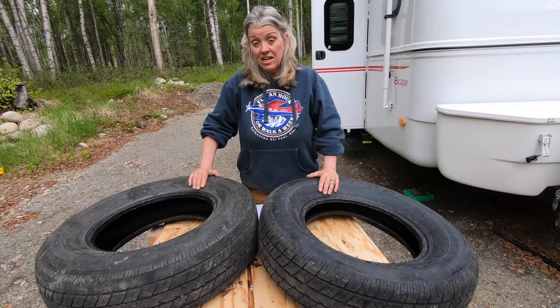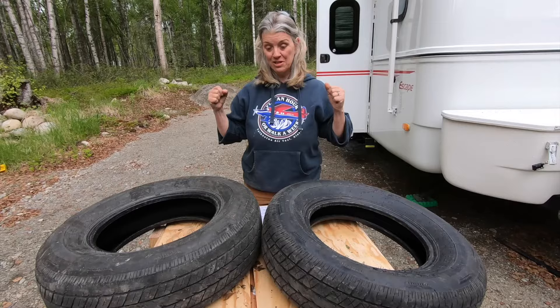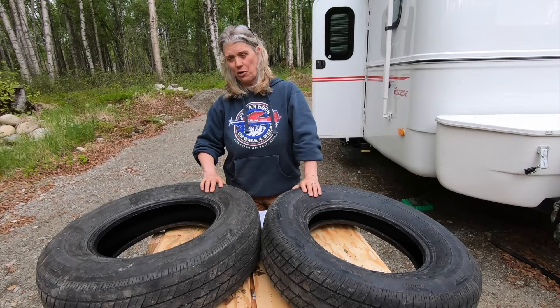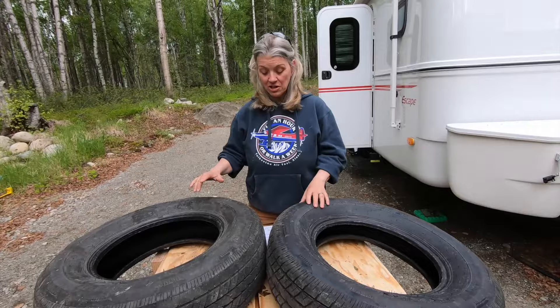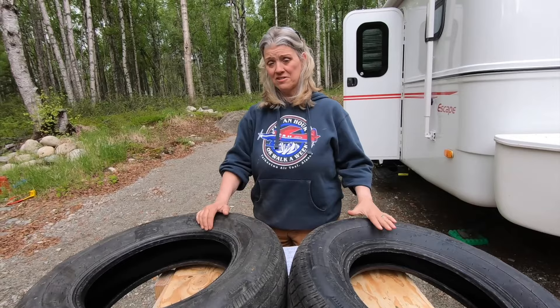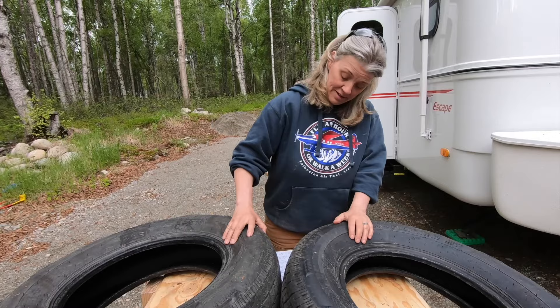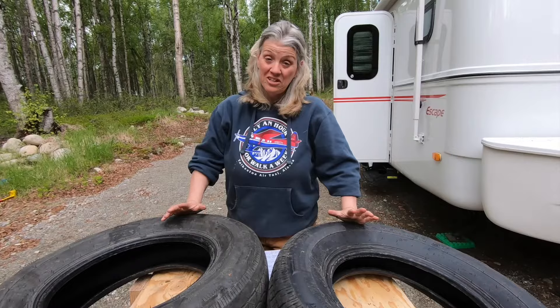Just remember when jacking up your RV to use the manufacturer's recommendation and your best judgment, and be safe. Now let's talk about the two mistakes I made with tires. Last year we had a bent axle — the axle was replaced, and one of the tires was really worn, which is how we discovered the bent axle. I looked at the other tires and they looked pretty new still, so I just had them replace the one. That's not really a great idea, but who wants to spend lots of money on tires? This year, looking over the tires before our next trip, I noticed the tire behind it was kind of worn on the inside tread. So I realized I should have just replaced all four — and that really is what you should do: replace all four at a time. That was mistake number one.